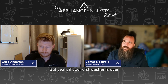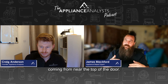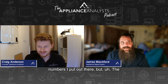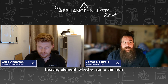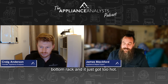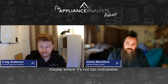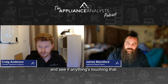But yeah, if your dishwasher is over 10 years old, it may be a board, especially if it smells like it's coming from near the top of the door. And then the other 5% would be an issue with your heating element, whether some thin non-dishwasher-safe plastic you put on the bottom rack just got too hot, or a plastic fork fell and it's underneath the heating element, maybe where it's not too noticeable. So definitely get in there and check and feel around the heating element and see if anything's touching that.